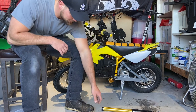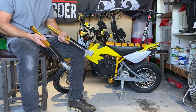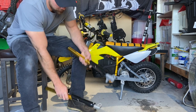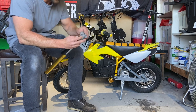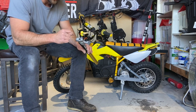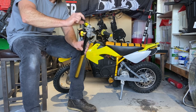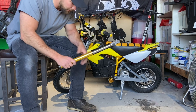Welcome back guys. It's been a couple weeks since I've done a video. I got some cheap forks off Amazon for about 60 bucks — they use them on these little pit bikes. It says the front's 12 millimeter but they lied, it's 15. The front on the razor is 12 and it's got a little bit of slop. So one thing I know to get these to fit right off the bat, I'm going to have to drill a hole, tap it, put a little screw, and cinch that down so there isn't any slop. A little ghetto, but we're going to make it work.